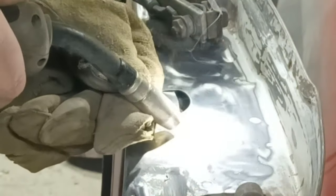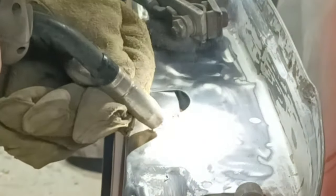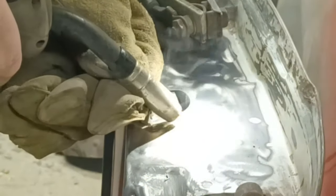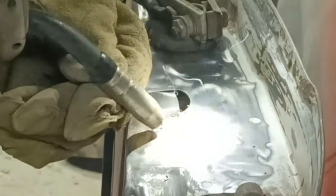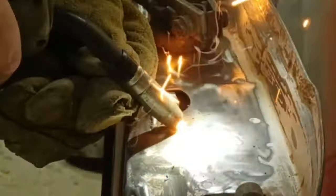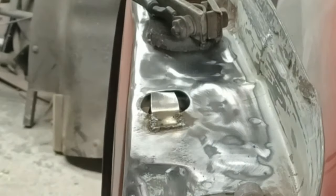So here I've zoomed in a bit so hopefully the quality will be good enough so you can see what I'm doing. Skipping around — I'm not overly concerned about heat and distortion here because it's lots of tight edges to take up the distortion and it's not a really visible part of the car, but I'm still skipping around the welds to try and minimize the heat. Just quick tacks as well, not putting loads of heat into the panel. The welder's turned up just over half and the wire speed is just over half, and you get a nice collection of tacks with that. You can see there that the heat hasn't traveled too far.